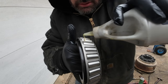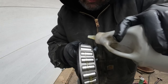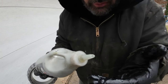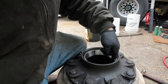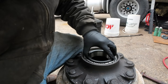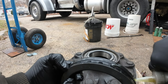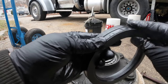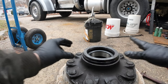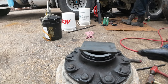We're going to pre-lube it with the gear oil also, just a little bit. A little bit on my finger on the race. Drop the bearing in. Now we've got to press in the seal. What I like to do is just a drop of oil on the rubber so you don't rip it — get the rubber a little wet. Do we have a seal press or brass hammer? His son's a diesel tech so he has the seal press. So I'm going to use this flat piece of steel — this works fine.